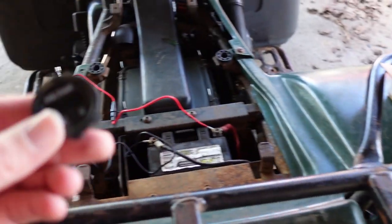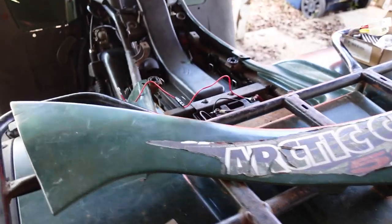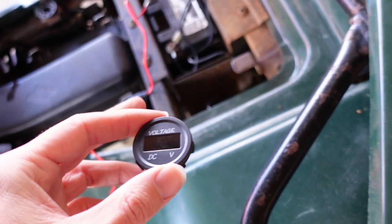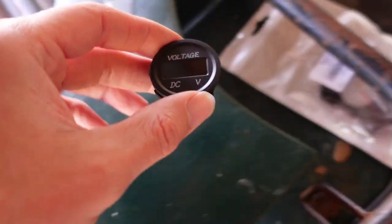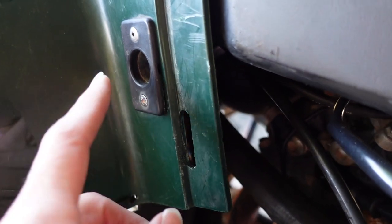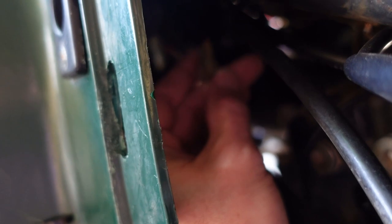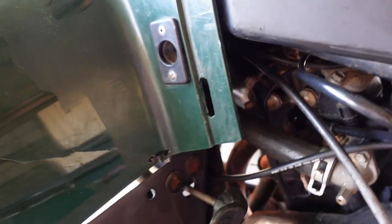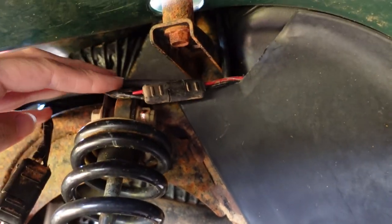Before we put the new rectifier on, we want to show how fast it drains - usually you'd ride the four-wheeler for like an hour or so before it starts trying to die out. As for hooking up the voltage meter, we're going to go directly to the battery for the time being, but we won't leave it that way because this will obviously stay on with the bike turned off. So we're going to try to hook it up to the cigarette lighter port over here. We've already got it unbuttoned and hooked it up, but we're not getting any power to it because this is supposed to come on with the key on, which would be perfect to keep an eye on the voltage.